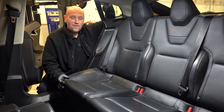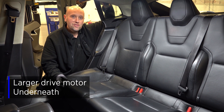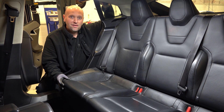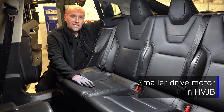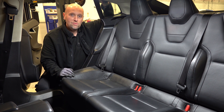We're going to check for the absence of high voltage. We can do that in one of two methods. If the vehicle has a large drive motor that can be done underneath at the connections to the inverter built within it. If it's a small drive you can't do it there — you have to do it under the rear seat at the junction box. We're going to do that here so it crosses all models.